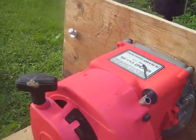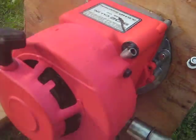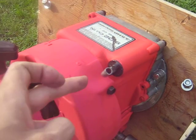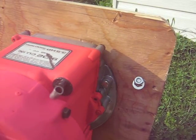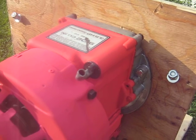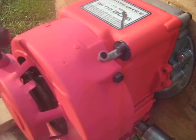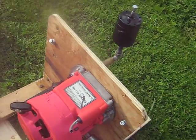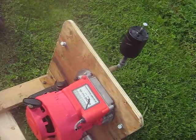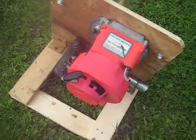You still need to let the blow-by gases out of the crankcase. So I put this tube in here into the normal dipstick hole — I drilled a hole in it and put that in so it's got about a quarter inch hole for the crankcase gas to come out of. On the video I didn't really see too much coming out of there, so apparently it works okay.